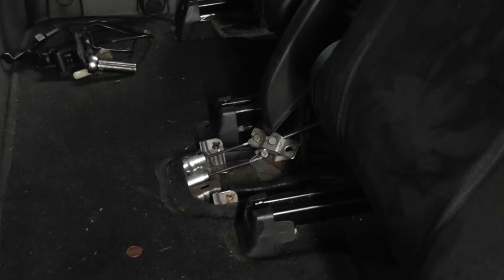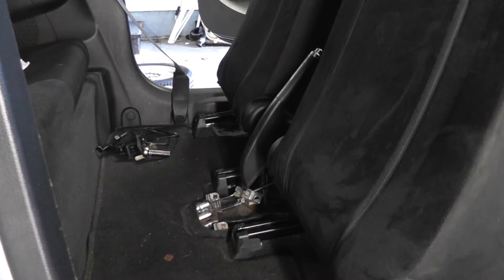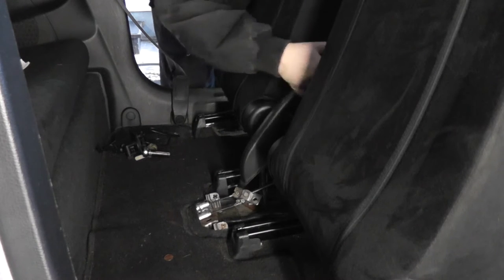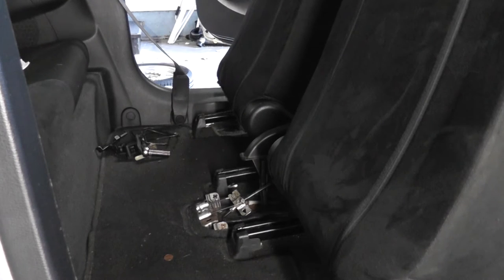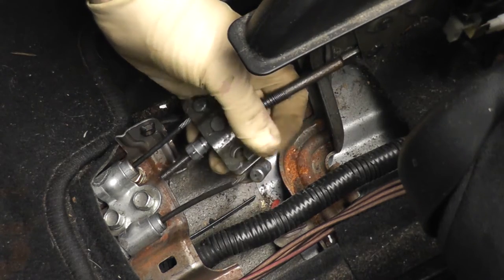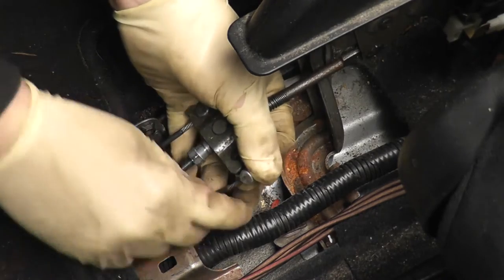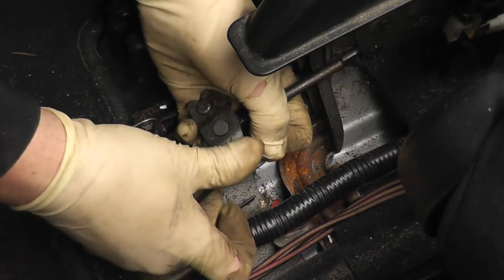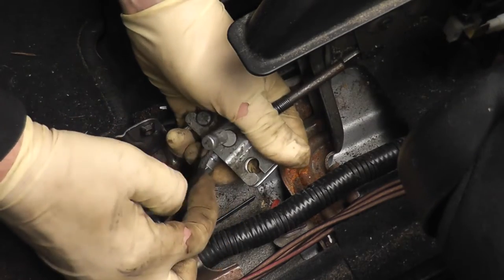As you can see in this video, the parking brake cable for the passenger side is disconnected. I did that because the cable had seized to itself inside the sheath, and I disconnected it to keep the rear caliper from hanging up. To remove the cable is pretty simple — you basically have to twist the cable so it slides out of that eyelet.